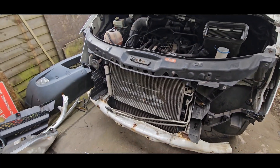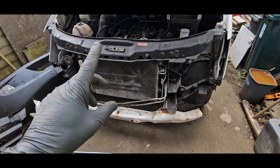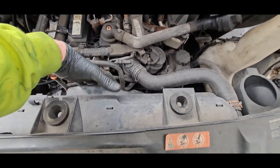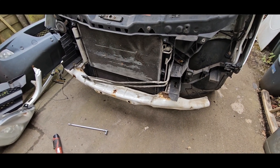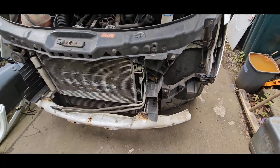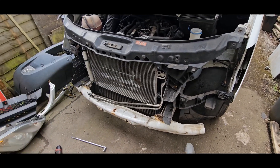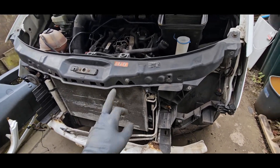It's going to be the slam panel next, then the air conditioning condenser. I might be able to make enough space to get to it then. It's not like the BMW ones where you can take it off and pull the cowl and fan off in one go — well you can on the X5 anyway. The intercooler is there with the radiator on top of it, so hopefully I can angle the AC condenser one way and the radiator the other way to get access.